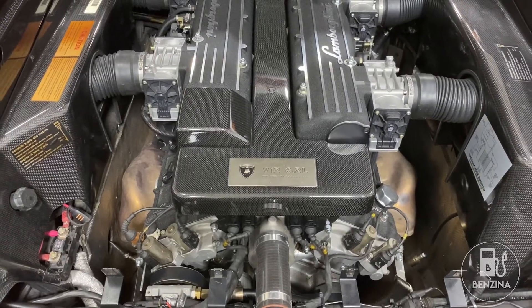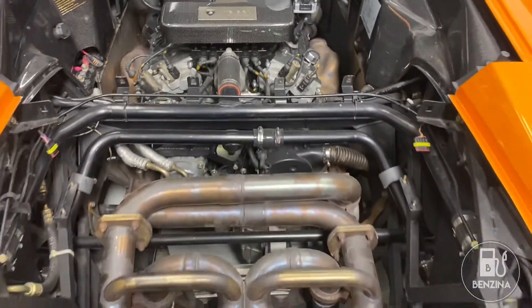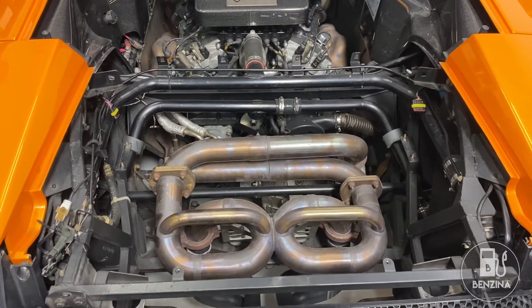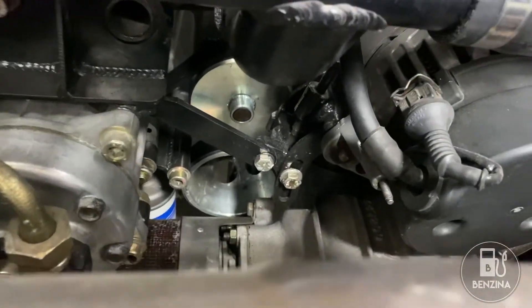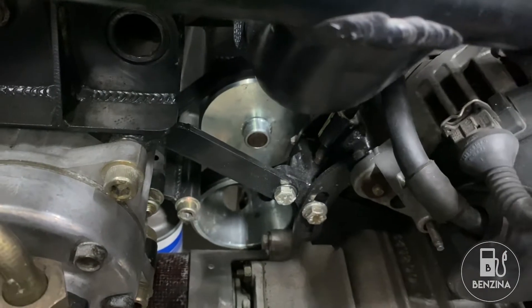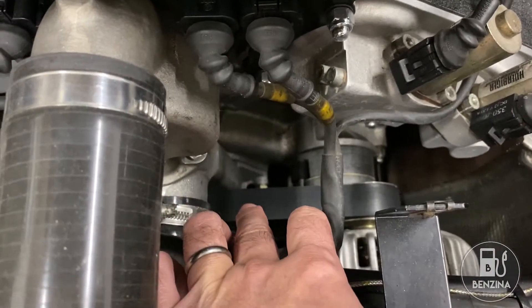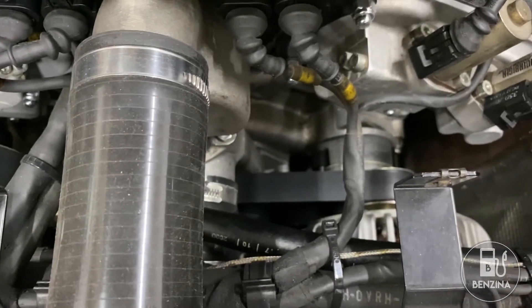In order to gain good access to the belt and the adjuster mechanism it is necessary to remove all of the rear panels, which is very typical of working on a Lamborghini Murcielago. Looking in through around where the exhaust is, there are the bolts that go to the alternator and the tensioning bolt that allows you to set the tension on the belt. The first thing we're going to do is pluck the belt right up top in this area, then using the Gates app we're going to see what the current setting is.